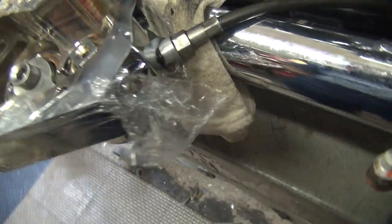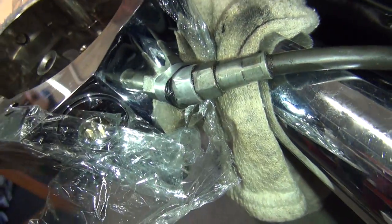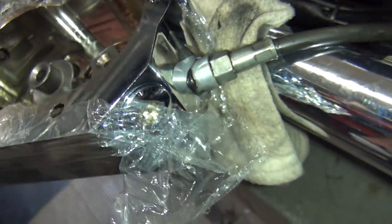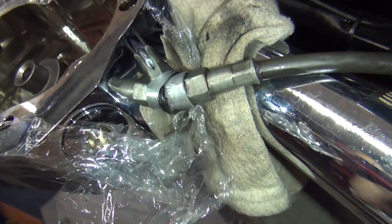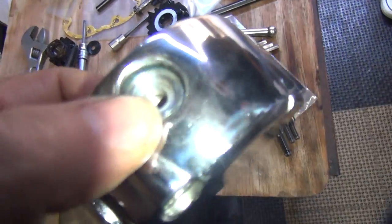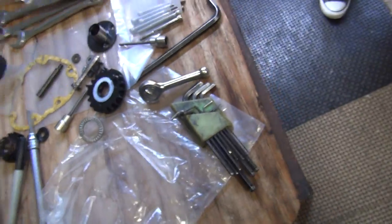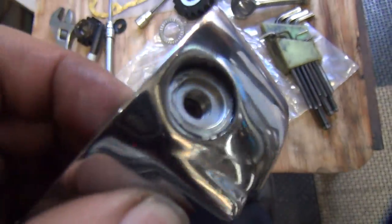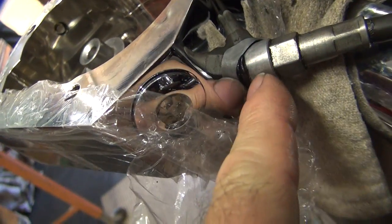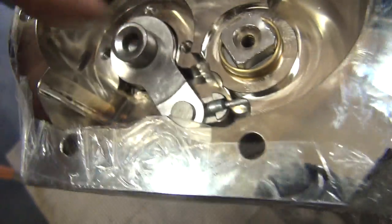Okay, cut. We need some parts. Find me the cover. Okay, I have a little bit of a problem here. I can see how the O-ring is just squished all out when I torque this down. So I think it might be an adapter in there. Need that easy kit in there. I don't use that. Anyway, this cover here has a recess counterbore for the O-ring. Right in there. And this cover here, I don't think it had it. But I also see now it looks like there's a bushing right here from that easy kit that we took out. So that's probably why the cable's so short and the lever's in the wrong spot. It should be over here. So I'm going to take this back apart and see what's in here, and we'll get right back to you.